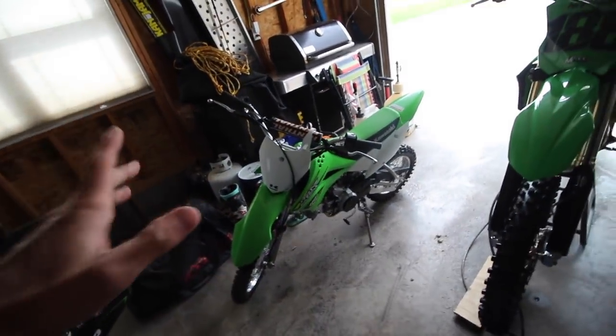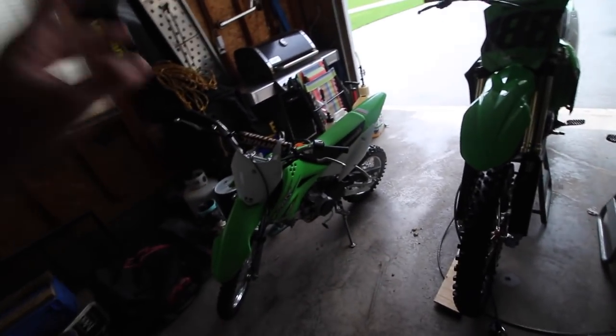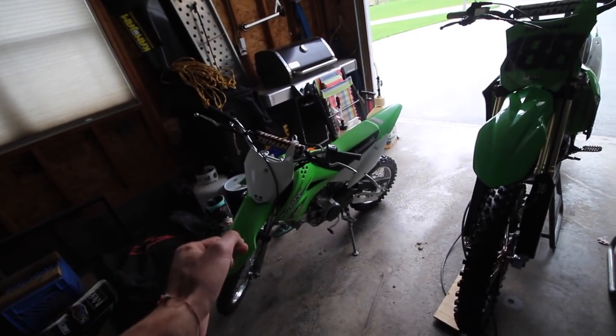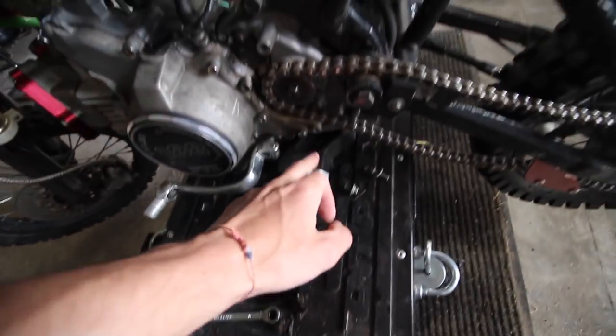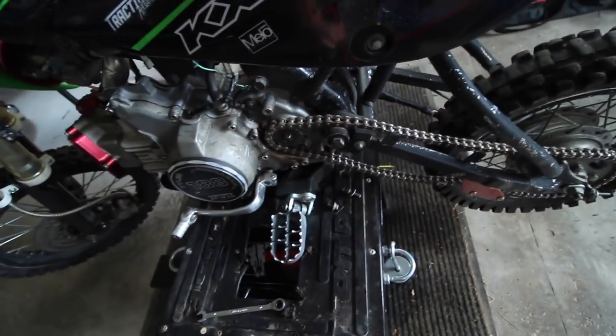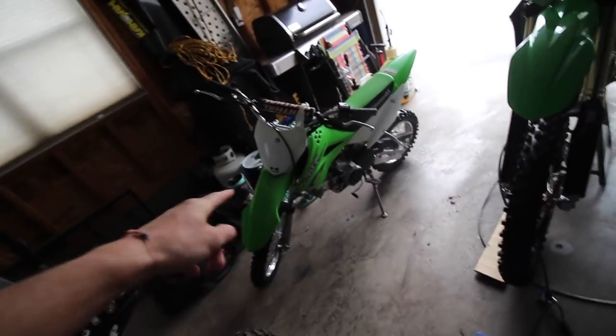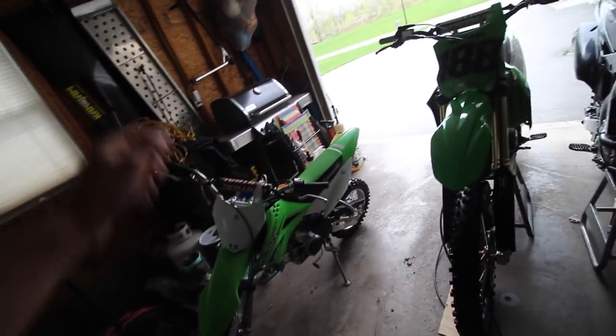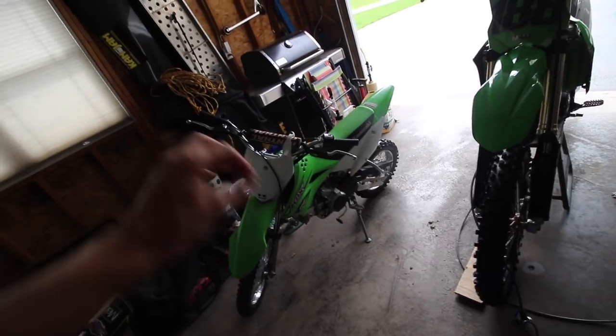I've probably been riding it for the past 20 minutes, and that really, really makes me miss having just a stock 110. Seriously, I think the way to go is just to have a stock 110, get some tall bars or medium bars, not even get a pipe, maybe put a 144 big bore kit in it, maybe the V2 head, get the JTI stuff, all the peg and cradle mount so you don't pull the stuff out, get the bigger foot pegs. And then maybe the swing arm, get the stiffer dampening rods for the suspension, get the better rear shock, like the Fox, whatever, that you can actually pump up with air to adjust yourself and for your weight and whatnot.